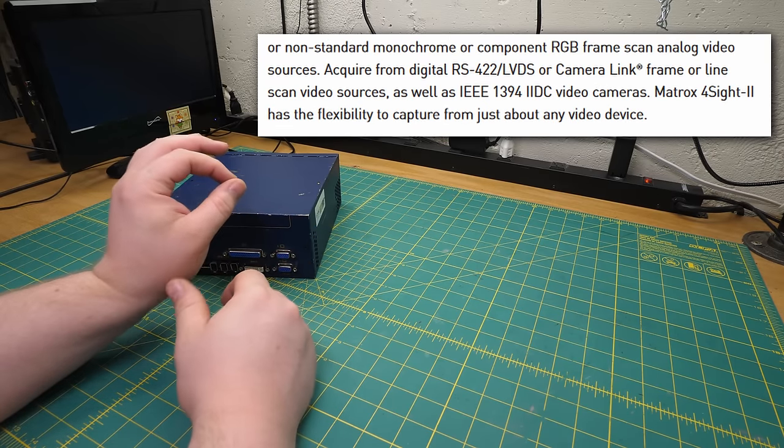The G450 in here is a genuine 3D accelerator — runs over AGP 2X and supports DirectX 7 or 8, so it should be able to run some 3D games more or less competently. But 3D was not actually the point. Matrox included the G450 to do video overlay, scaling, and multi-head output. Multi-head really had been their bread and butter for a long time — they made some very early dual-head cards, as well as a long-running series of single-to-multi-screen converters like the TripleHead2Go. I think they also had native TV output before ATI and NVIDIA did.